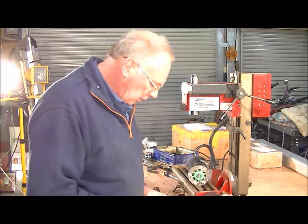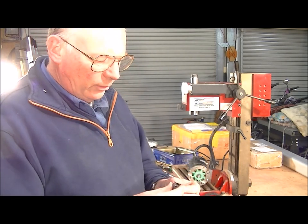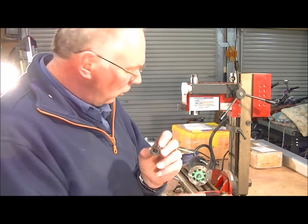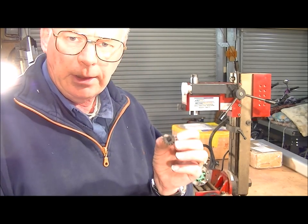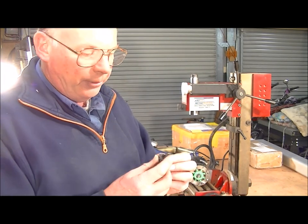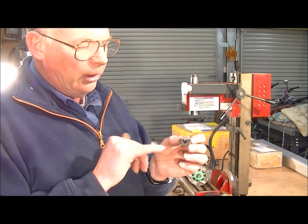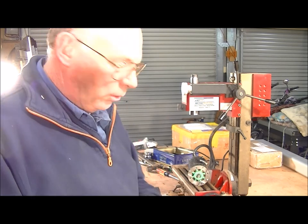What I had to do was get an angle grinder with a slitting disc and very carefully cut through the gear. You've got to be careful that you don't transmit any heat into the shaft because the end cover is plastic. It's the best way I could come up with to get that gear off. You may have a small puller, but I just used the slitting disc and it popped off with a pair of pliers. Keep that in mind when you're changing it over.